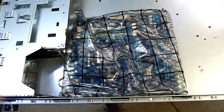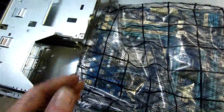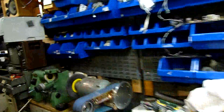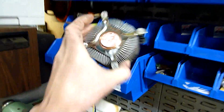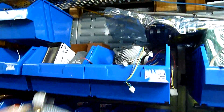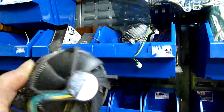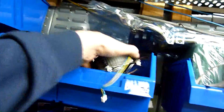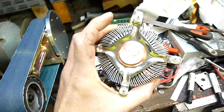That looks good — that's the actual main board sitting on its mounts. Plenty of clearance in here. Even the big CPU cooler won't hit the side, but I'm using the factory air cooler for the time being. That's a Pentium 4 cooler with a solid copper core in it. I might actually replace the busted push pins on it and use that. I know the i-series doesn't generate as much heat and runs a much smaller cooler, but I might just go a bit over the top on it, especially because it's going to be in a shed and come summertime, if I don't have water cooling on it, it's going to get hot.